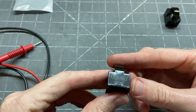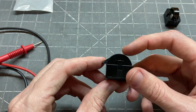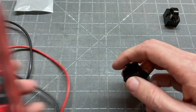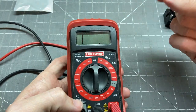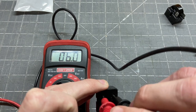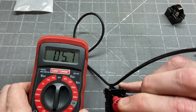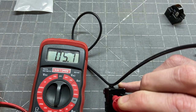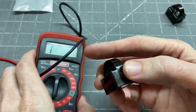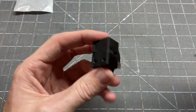Are there any markings on this one? You can see it's 4R7, which is how this one is marked. We have one flat pin and then two holes in the bottom — these are marked start and motor. We're going to turn this back to our 200 setting. You can see we're at 5.8 ohms. There's a little bit of acceptable tolerance — usually it's plus or minus 10%, so pretty much if you're anywhere close to five ohms it should be good. So this is our good one.